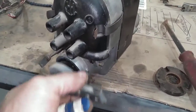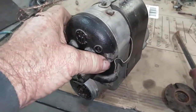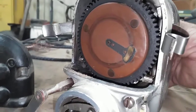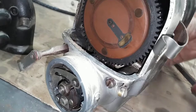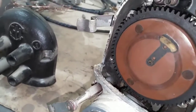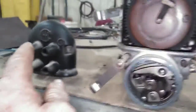Take this clip and remove that cover, then remove the distributor cap. Here's your pointer. Number one cylinder is generally here on these F4 magnetos, so that's where you want to turn it to line up with number one. If you turn it clockwise — in the rotation that the magneto turns on the engine — your impulse may be set. So I turn it backwards so I don't have to deal with the impulse, and I get the pointer pointing in the general direction of the number one cylinder location — the number one spark plug wire location on the distributor cap.